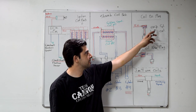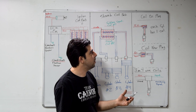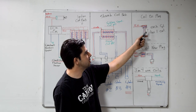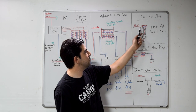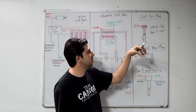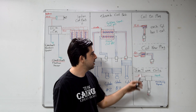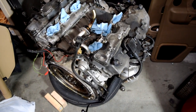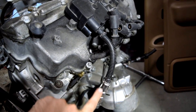Next up are coil-on-plug setups. Each cylinder has its own coil, and these coils sit on top of your valve cover with no spark plug wire. The wires from your ECU or ignition control module connect directly to each ignition coil, and the coil-on-plug type goes directly over the spark plug itself. You have 12 volts coming from your ECU and a signal wire going back to it. When it's not possible to place the coil directly over the plug, the next option is a coil-near-plug, where a short spark plug wire runs from a coil on top of the cylinder head or valve cover to the spark plug — like the setup on this 2002 Mercedes 2.6-liter V6 engine.